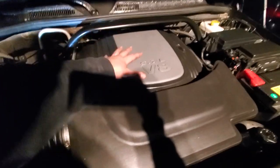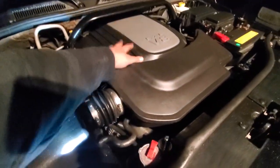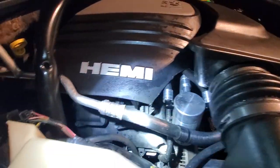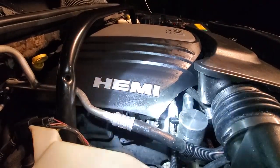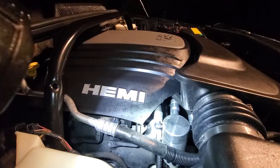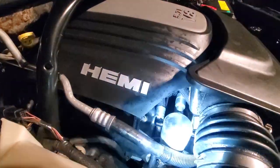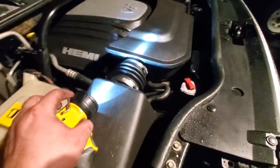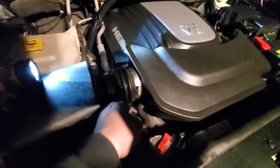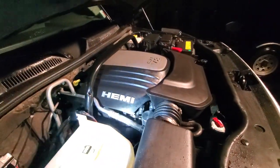All right, guys, when I popped this shroud on, it was a little cockeyed because, well, I realized this over here was hitting my hoses. So I just took the cutoff wheel and I made a nice smooth arcing cut over the shroud to get around the catch can. So there you have it. When it's time to empty it, I'll be able to empty it by just taking off the air box, and then I'll be able to reach down under there. So that's it. Pretty cool, guys.